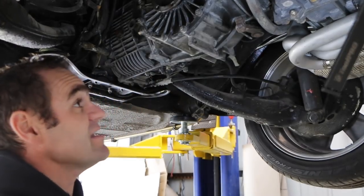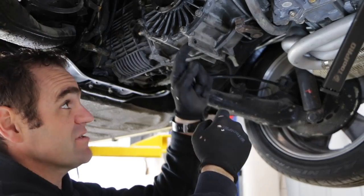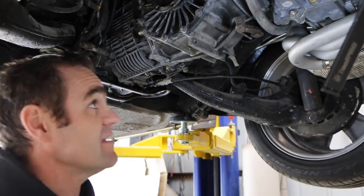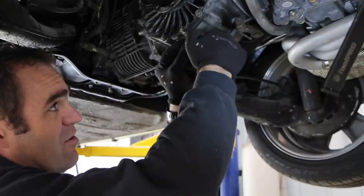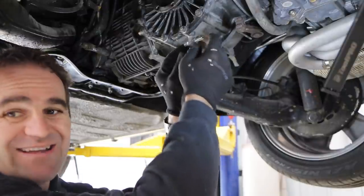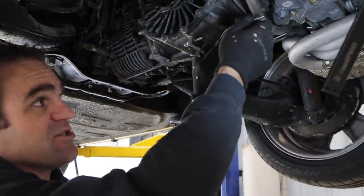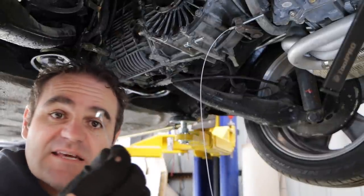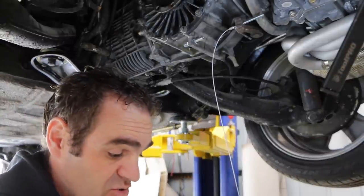I'm underneath now, and this is the standard clutch arm. It's already connected to the clutch on the inside, and there's a tab on the bottom of the gearbox here that the clutch cable normally runs through — that's your solid mount, and then it pulls this arm towards that mount. I've got some fittings here and this one is the right size to fit through like that. I'll finger-tighten that up, leaving it all the way in so I can tighten it later. There's going to be a bit of adjustment in this anyway. The cable will go through like that into my sleeve, so I need to trim off the swage on the end and start feeding it through, and work out exactly how much cable I'm going to need.